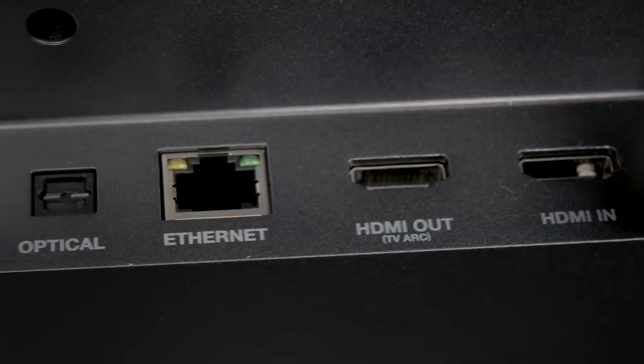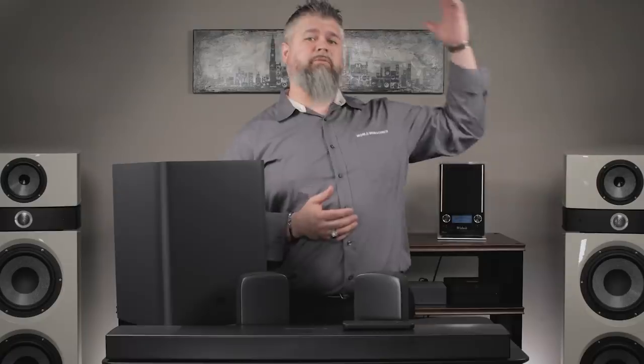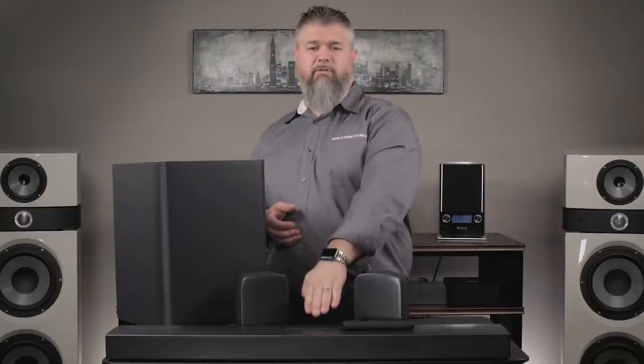As far as connectivity goes, on the back you'll have an HDMI in and an HDMI out, and it is a 4K pass-through, so if you send a 4K signal through it, it will go up to the TV. But if you have multiple sources, you may want to connect all of your sources to your TV. Most of today's TVs have four HDMI inputs, one of which is labeled ARC — Audio Return Channel. If you connect that spot on your TV to the HDMI ARC on the JBL, all of your sound from all those other sources will come into the soundbar.